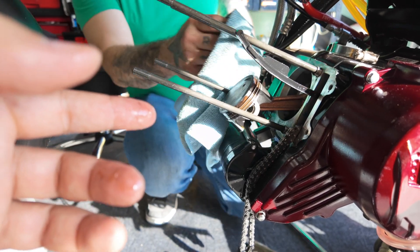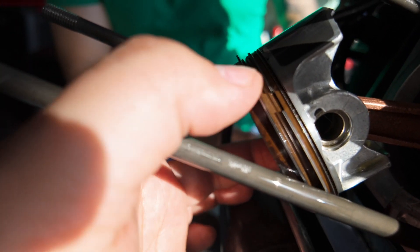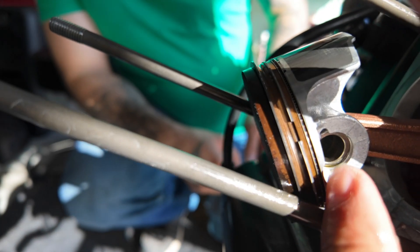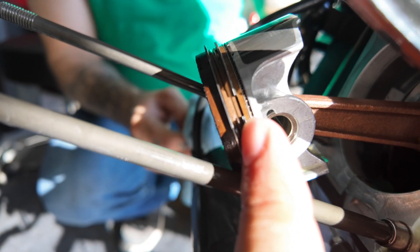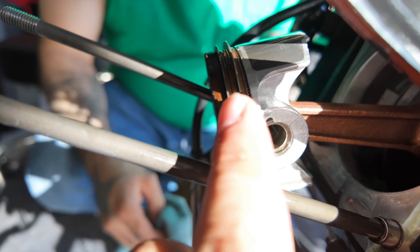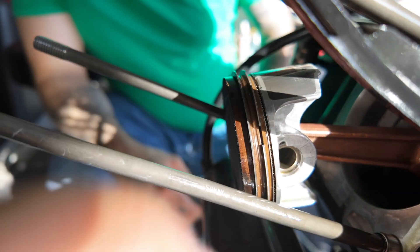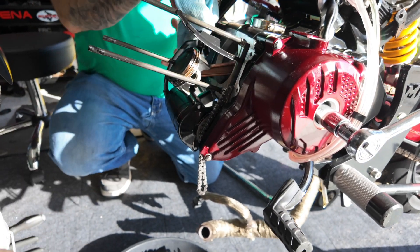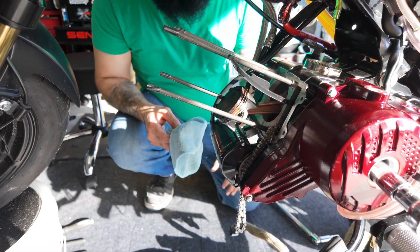Same thing we're doing — for those that don't know, when you're putting a piston on, you want to look at what the other one had. Right here on the rings: you have the oil ring on the bottom, then you have the light white ring in there, and the dark ring on top. We gotta do the same thing when putting these on back in the jug. These openings you do them all triangular — first opening on top, second one on a corner, and the other one there — so the gaps in the cylinder are far apart.